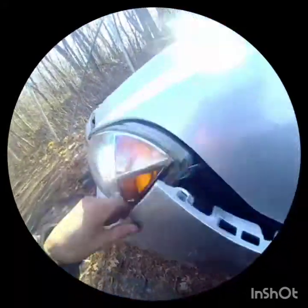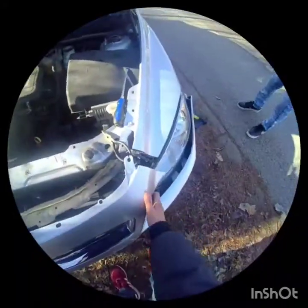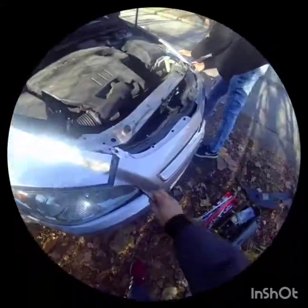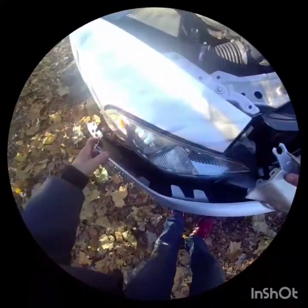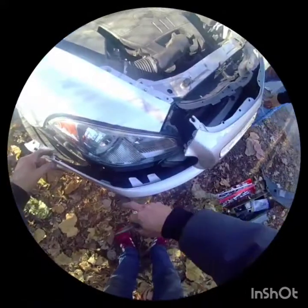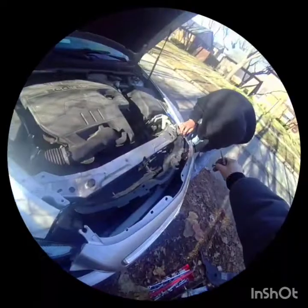This just pops out — I'm guessing the whole bumper just pops forward. There's probably gonna be some tabs on the bottom. They look like they're seven or eight millimeter, a couple more plastic tabs. Just need to move it far enough so we can realign the lights, but that's pretty much everything. The bumper's off — you just have to get the tabs and the other little screws from the bottom and everything comes out.